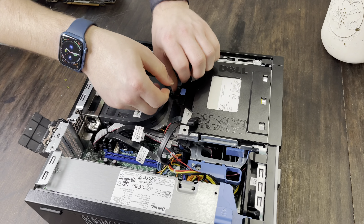As soon as the card automatically downloaded its driver, the screen flickered off and I got the black screen of death. My first attempt was to remove the card and reboot using a super old VGA cord. I tried downloading a new driver, but it wouldn't let me because the card wasn't in the computer. Next I put the card back in but left the VGA cord connected — it didn't like that either. So I booted into safe mode and used Display Driver Uninstaller to manually remove the Intel Arc graphics driver. After the computer restarted, I had a driver-free system and was ready to start over.